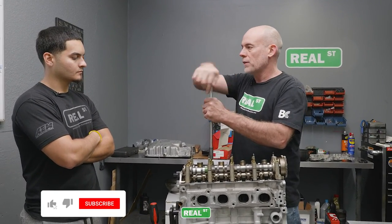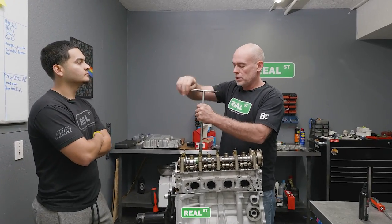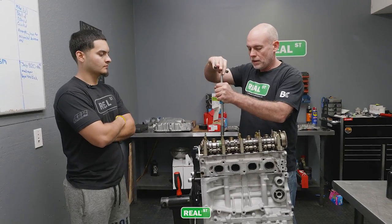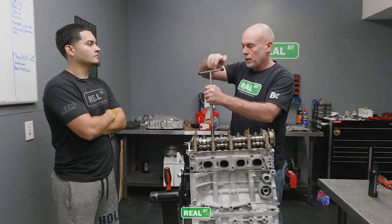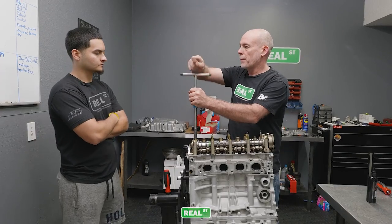Like when you hear camshafts that are rough at idle, you're listening to the overlap. The intake valve and exhaust valve are basically open for some period at the same time, and air is passing through the engine. And that's how you get that chop.